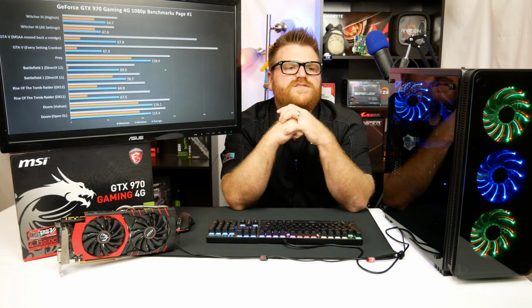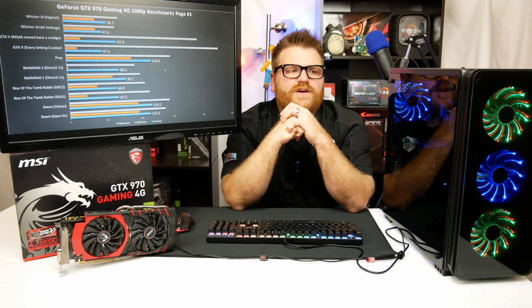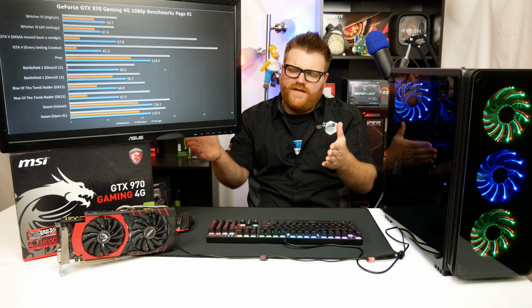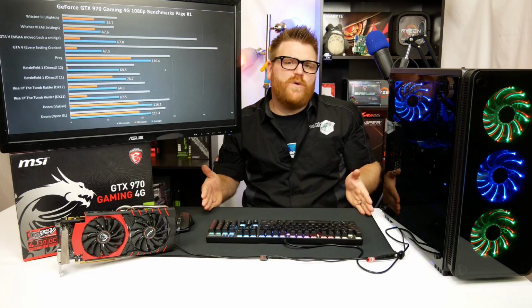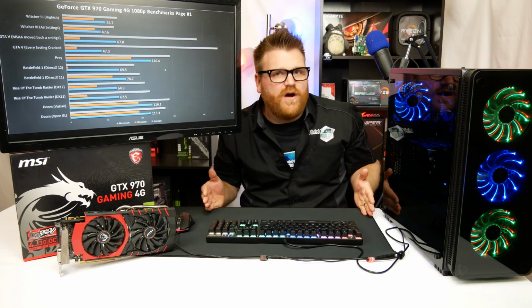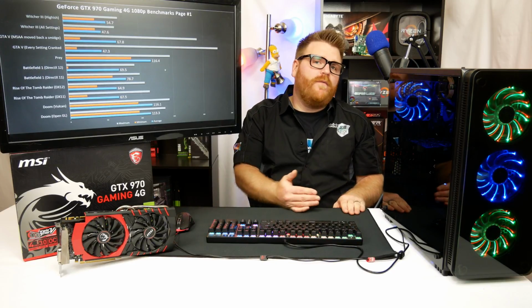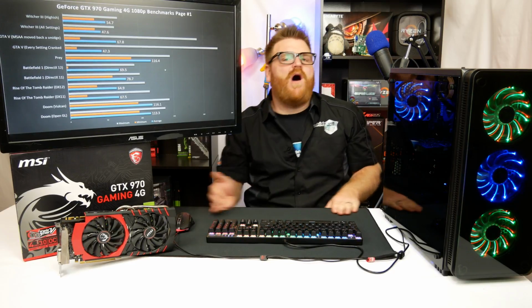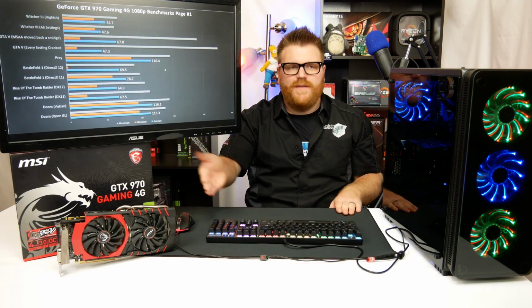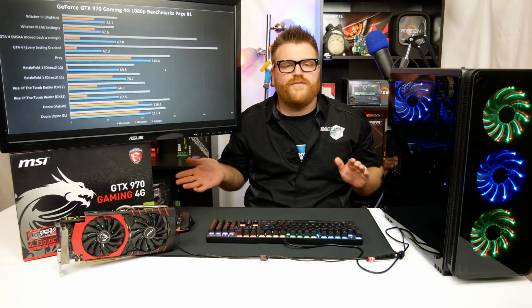So, moving on to Rise of the Tomb Raider, every single freaking setting cranked. DirectX 11 and 12 in these. I wanted to see if on the older Nvidia GPUs, DirectX 12 was helping yet, because if you run any sort of AMD card, you generally get a lot better performance in DirectX 12. It's the opposite with Nvidia cards. Well, I wanted to see if maybe some driver optimizations had made DirectX 12 better for older Nvidia hardware. We'll see across the board here, that's not true. Okay, stick to DirectX 11 if you run an Nvidia card.